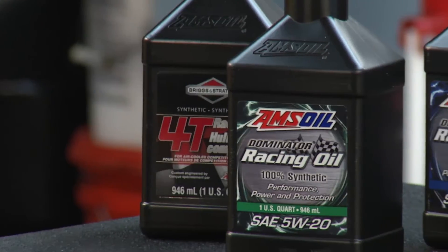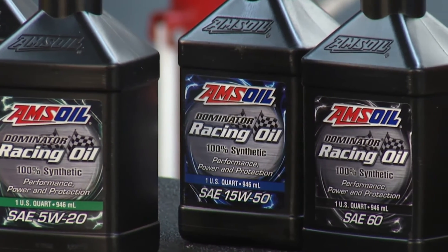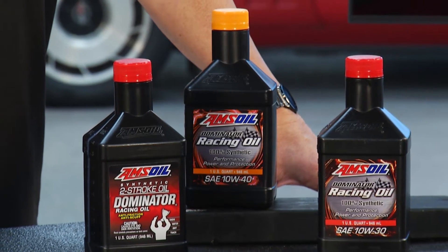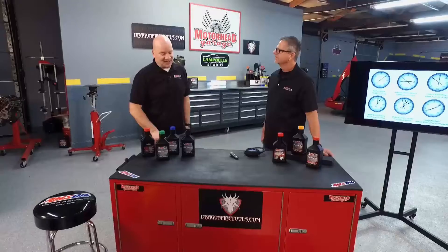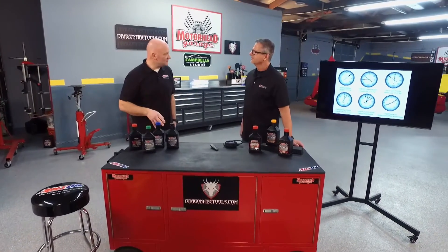What are you going to do for high-performance cars with AMSOIL? From an oil standpoint, that aggressive camshaft you're talking about requires more additives and more wear protection — basically a boosted formulation. Our racing oils, when we're speaking ultra-high performance, are fortified with that. It's got boosted zinc — that's the key word everybody knows — boosted anti-wear additives, and very robust heavy-duty base oils to provide the protection that those racing engines require.